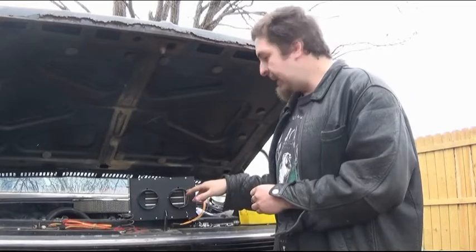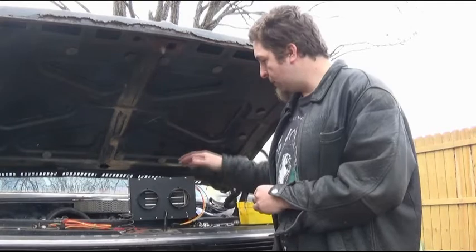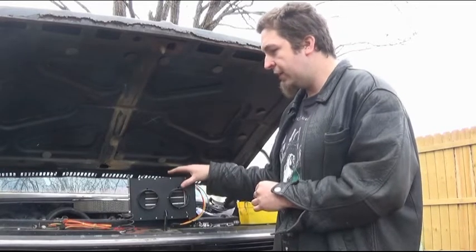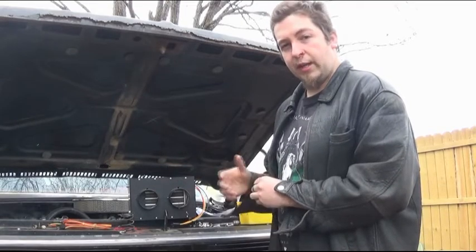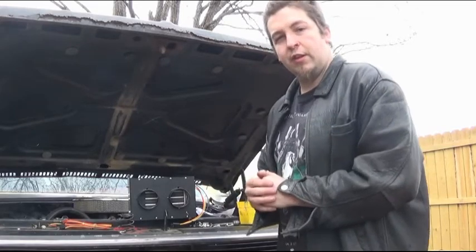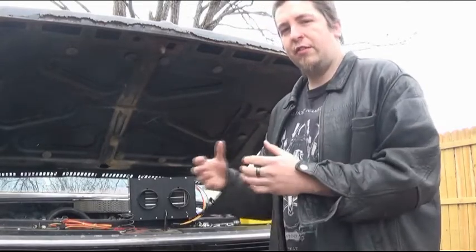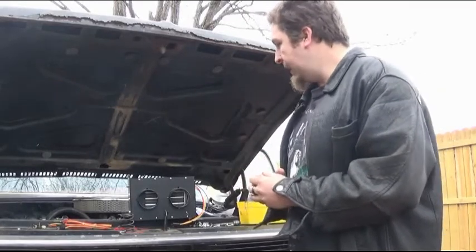Usually you can buy a kit to go with this for the ducting. We're doing it a little bit different, but we're going to be installing this unit. I went with the larger heater instead of going with the defroster because I really wanted something just to keep the windows defogged in the wintertime, or when it gets cold and there's a little bit of moisture. But at the same time, it's a truck. Since it's a truck, we have a smaller cab space, so hitting the windshield first, it'll still heat up the cab very well.